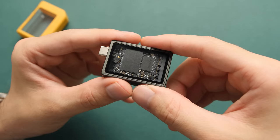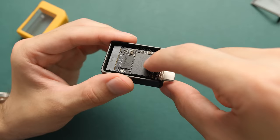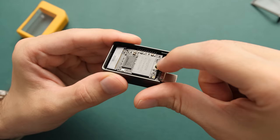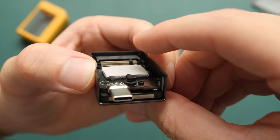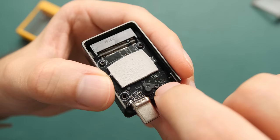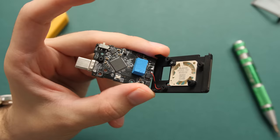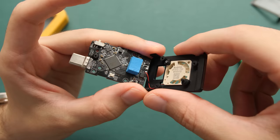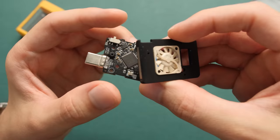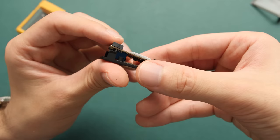Right now I have a 512GB drive in here, but I'm going to swap it out with a 2TB one that has all of my games. Changing the drive is pretty painless — all you have to do is push up on the lid and it comes free. You'll see that the drive is just held in place by a little rubber nub. Lift that out of the way and you can take out your drive. Underneath is a pretty thick thermal pad and the main PCB with the fan on the bottom. This thing uses T6 screws. On the other side we have a very small fan with a Realtek controller that handles the business end of the device, and that big thermal pad is on the back.